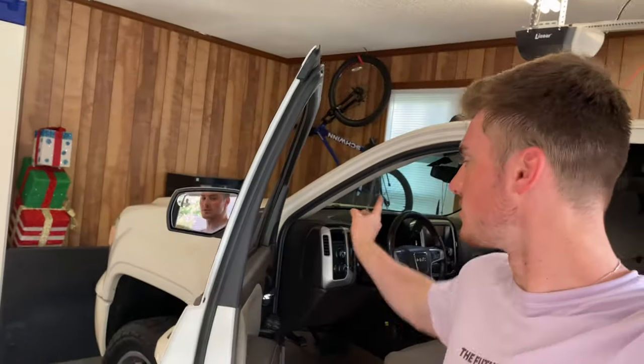If you're experiencing any of these problems, definitely try out those two ground fixes. I watched multiple videos and it was either one or the other — I think I'm the only person I've seen that did both. They also mentioned there's a secondary one on the right side of the dash that you could fix, but supposedly that one doesn't interfere with the ignition. If I ever have problems with AC cutting on or off, I'll go back and fix that. All I did was cut the little foam pieces interfering with the dash ground, then used a butter knife, some sandpaper, and a little bit of black spray paint to fix up the body ground. Thanks for watching — I hope this helps you. Like, subscribe, do whatever you want to do. See you later.